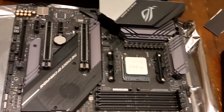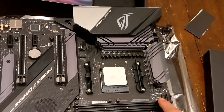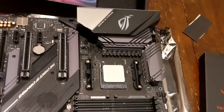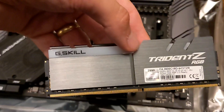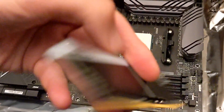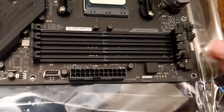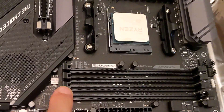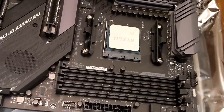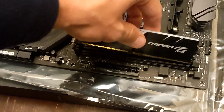The last thing I'll do in this video is the RAM — I'll do the water cooler in the next video. I want to finish off with the RAM and then we'll look at the case to figure out the water cooling. There's one of the sticks — not sure which way it faces, so we'll try both. I gotta open up the pins here — it's only one side, opens like that. We want to do this one, skip one, and do this one.